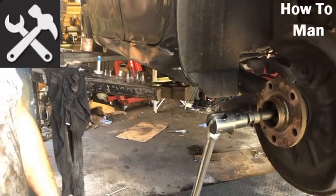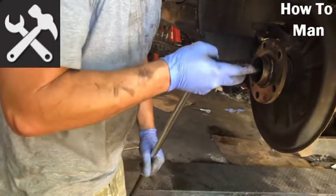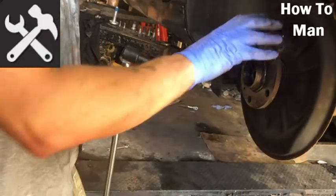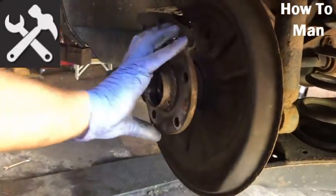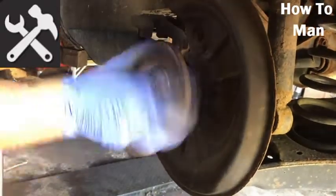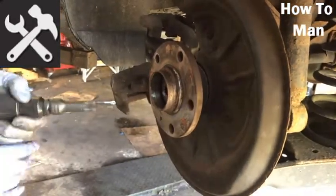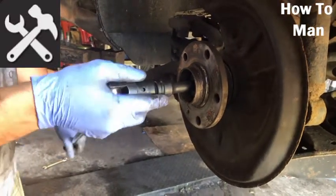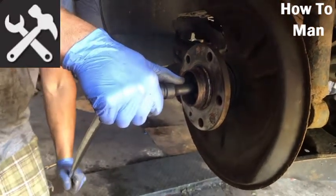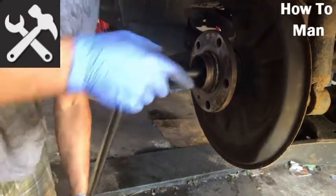Part 2. Right, so we've got a breaker bar on it. Obviously I'll give you a demonstration of what a bad wheel bearing sounds like, if we can get the sound alright. That shouldn't have any noise, if you can hear any noise there. That should be absolutely silent, so we confirm it definitely needs changing, it's dead. Damp will have probably got in or something.